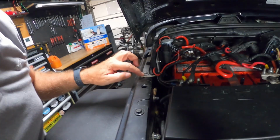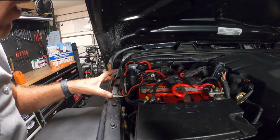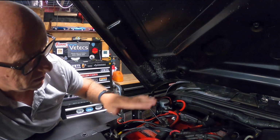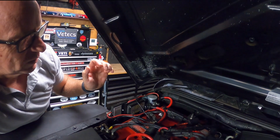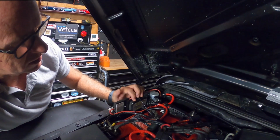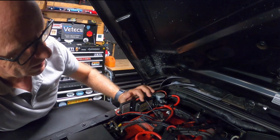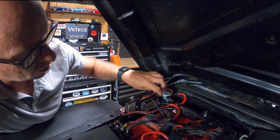So I have just installed an aluminum angle bracket over here, which I just made myself DIY, bolts down over here, bolted the controller and the relay onto it, and it fits pretty good over here. I will add though, the one thing I am not too pleased with is that this control module, the National Luna Intelligent Solenoid Control Module, is not IP rated. So it clips together. It's got two self-tapping screws behind this label that holds this little box together.